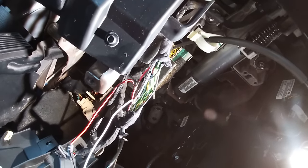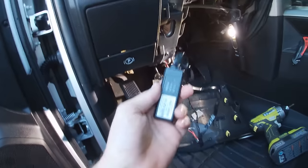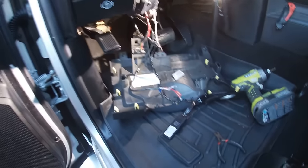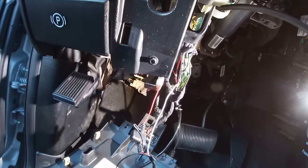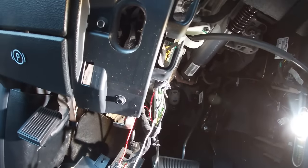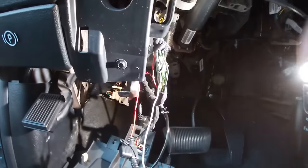So I'm going to unwrap these wires, put electrical tape around them — it's not gonna hurt anything, you just don't want the two wires touching each other. And before anybody says anything — because I know there'd be that one person — tracking devices dealerships do put on for people with bad credit, so if they're not making payments they can find and repo the vehicle. This is not that situation. I don't have bad credit, I pay my bills. This has been in here a long time, and I can tell because of how bad that relay wire harness is. It's been in here probably since the truck was new — it is a one-owner vehicle titled in Ohio on the Carfax to a fleet company.